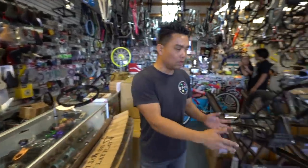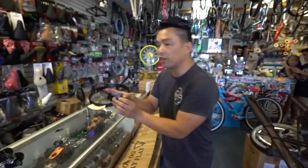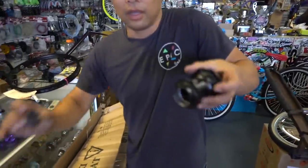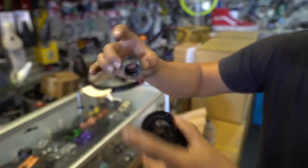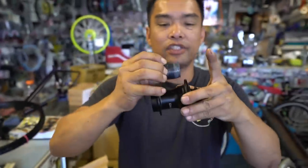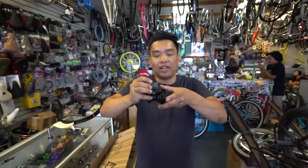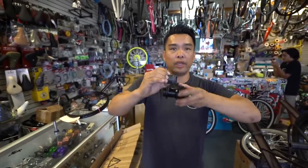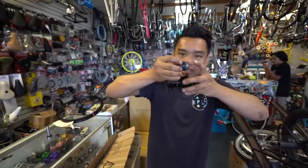Why is it that the crank won't move when you go backward on a Freecoaster? Because the Freecoaster has this little clutch, and you can't see it, but inside, when you pedal forward, it screws in, you see the little screw marks? This part binds into the hub shell and propels the whole thing. So when you go 180 and this thing unlocks, there's nothing to catch. There's no pawl and spring to catch, whichever way you go, unless you pedal forward.